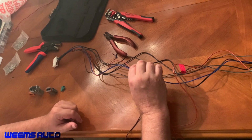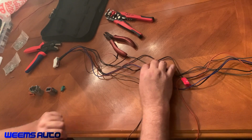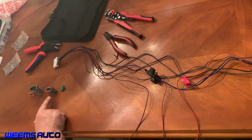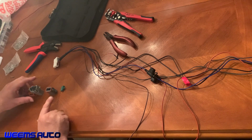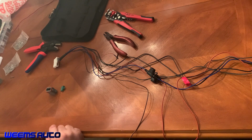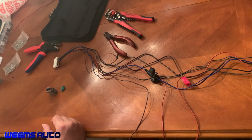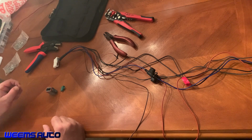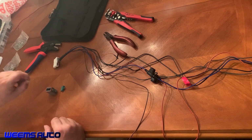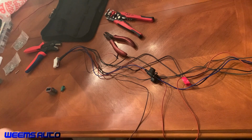I'm going to cut them off right here, strip it, and then I can show you how to make these connectors. There's two parts of it. You have the male and the female. We're going to make the male section. And in the car, in the next video, I'll do the female section. I think this is going to be a whole lot easier than trying to solder all of these wires up underneath the dash. So actually on the male connector, you actually use a female pin. So let me get all these wires cut down and stripped, and then we'll get to crimping these connectors on.